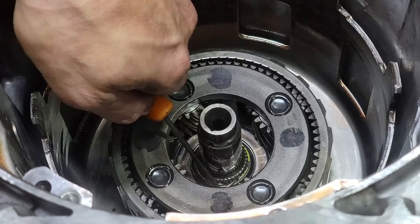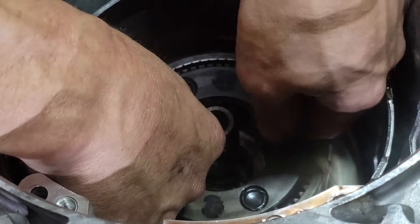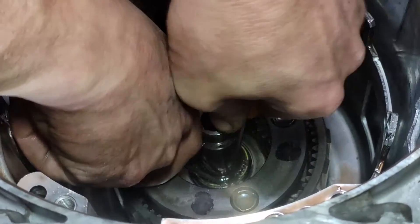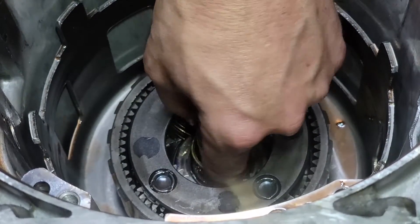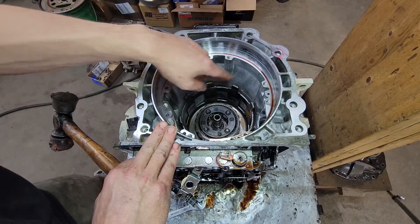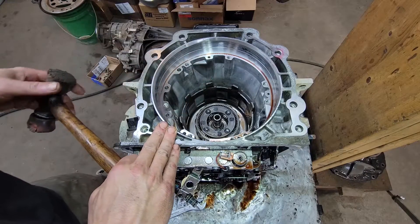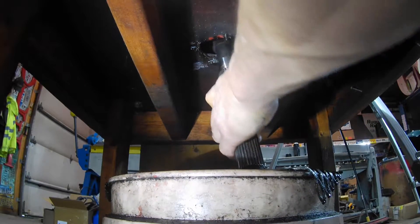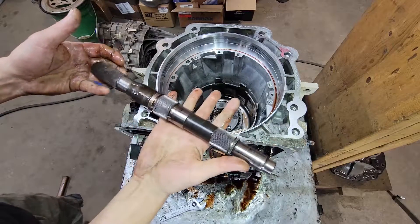We'll get this clip spun around so you can see what's going on. The opening of the clip is right here where the end of my pick is. I'm going to hold one side of the clip and try to get underneath the other side. There we go. Time to pump the brakes — a couple of other videos I've seen on this topic take the rest of the crap out of here, but there's no need for that. This is the end of the line, we're done taking things apart if all you're after is the output shaft. Rubber mallet again — see you later — and there's our four-by-four output shaft.